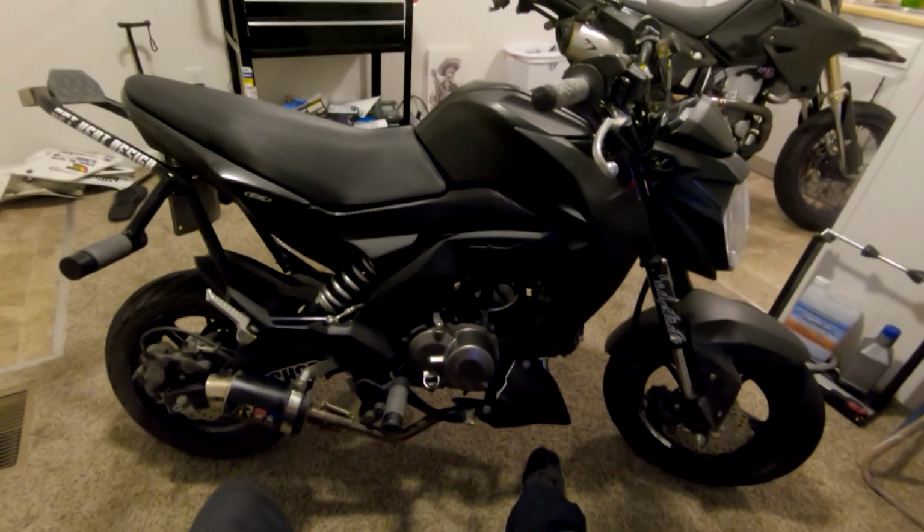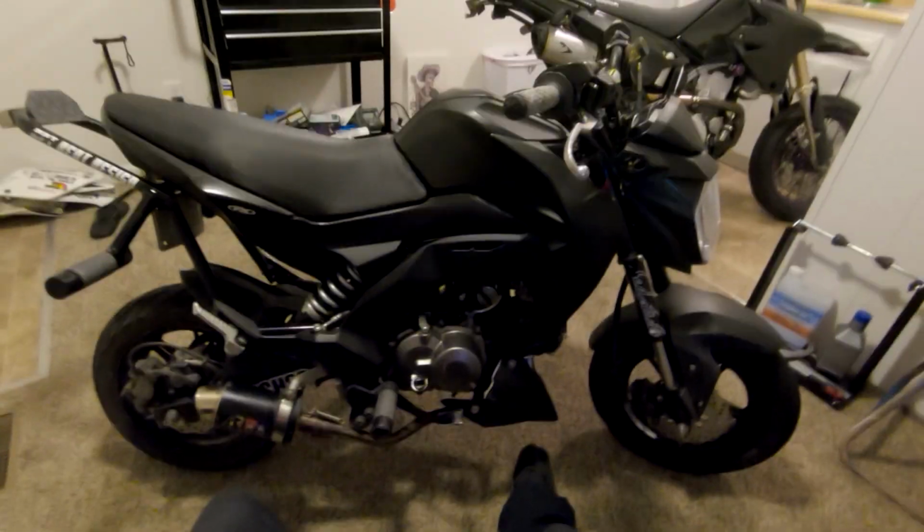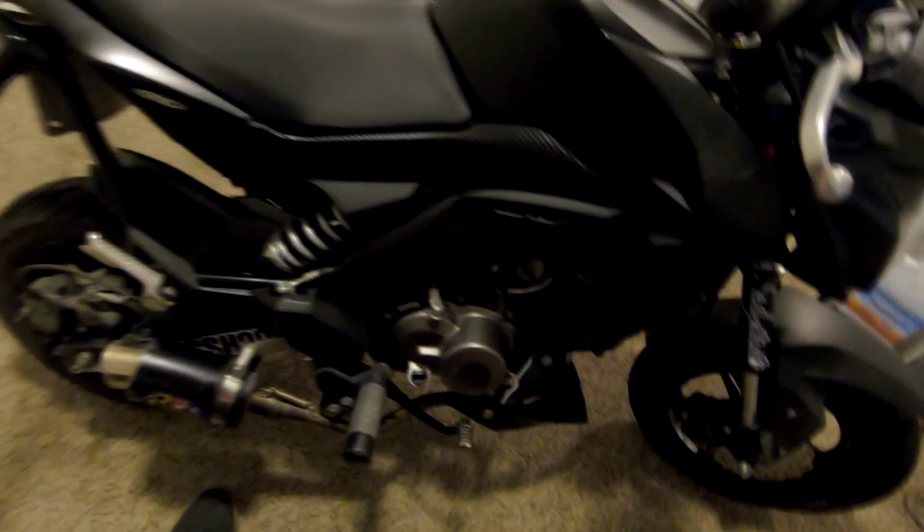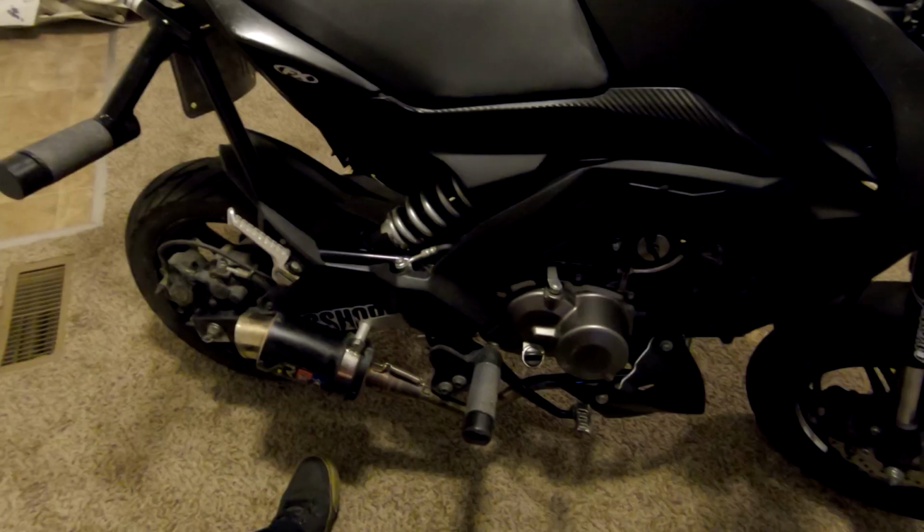It's very much like the DRZ is, in the fact that it's very straightforward. You know, as long as you're getting good parts, there's not a lot you could go wrong with on this bike. It's not like the Grom or the DR. There's no oil mod that's needed to be done. The oil pump is in the back of the motor, so you can ride as long of wheelies as you want to on this bike, and you'll never starve for oil. But yeah, I mean, it's sick.